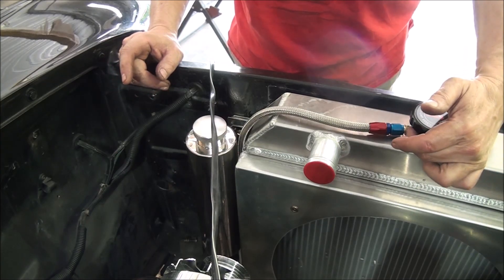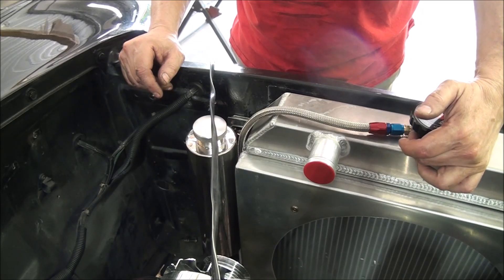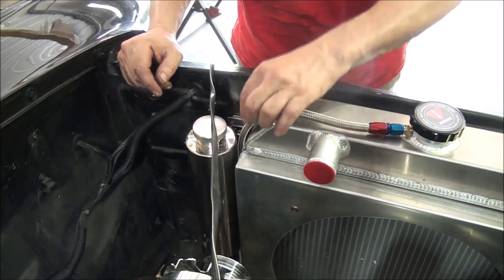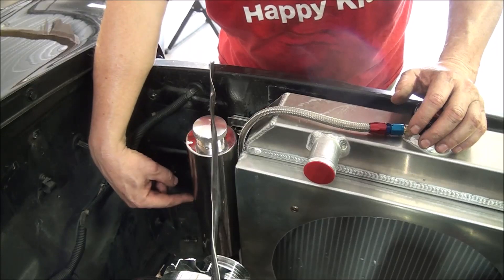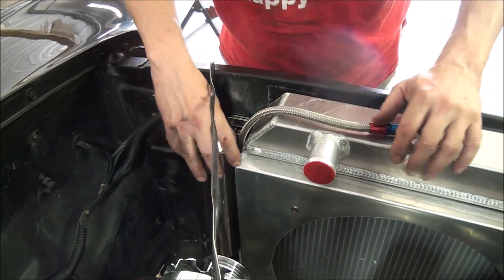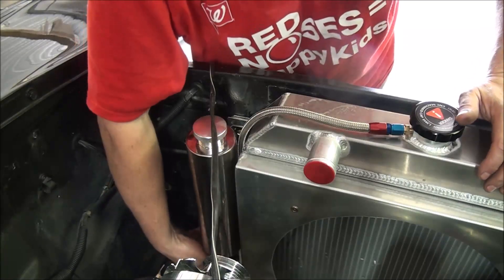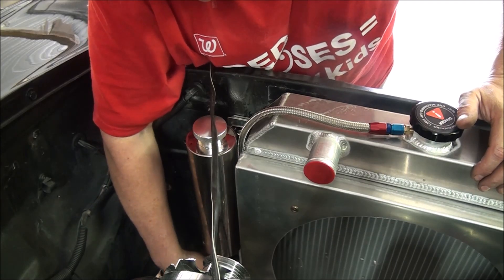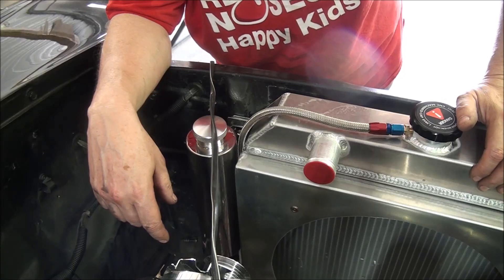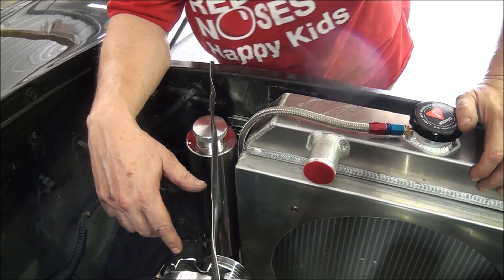To recap: to get the 1/16th NPT on the radiator neck, I went with an NOS nitrous oxide fitting — that's 1/16th NPT on one end and dash 4 AN on the other — an AN straight fitting, number 4 AN braided stainless steel line, a 180 degree AN fitting on the bottom, and a compression fitting on the tube that goes to AN flare. This is all installed nice and solid. The chances of this thing actually overflowing are pretty slim. I just have the outlet pointing straight down at the steering box. If the owner sees fluid out of that, he'll probably put a small hose on it and route it through the lower clamp built onto the radiator.